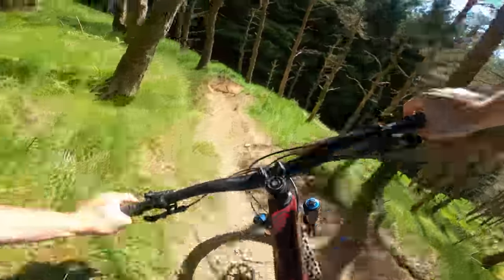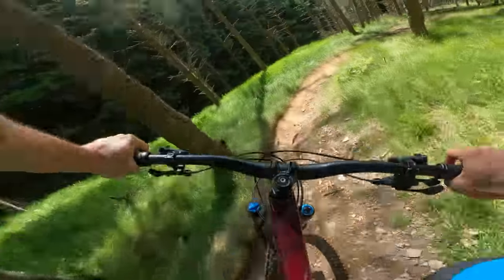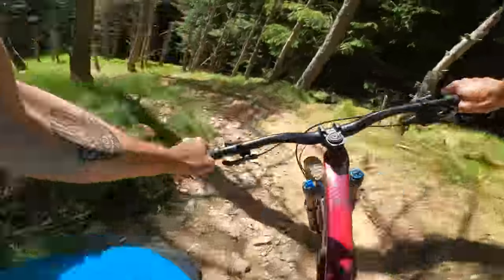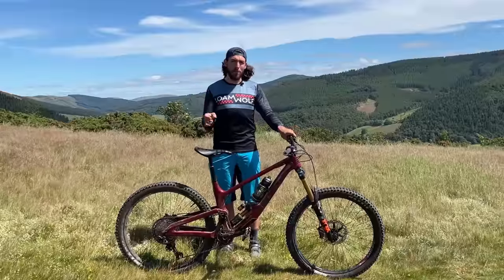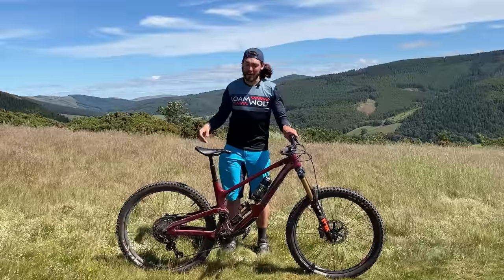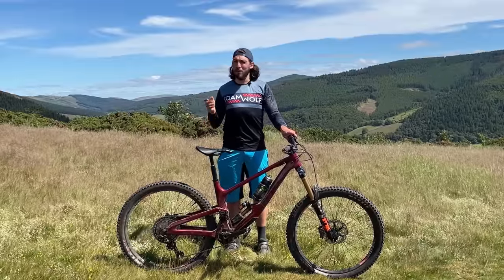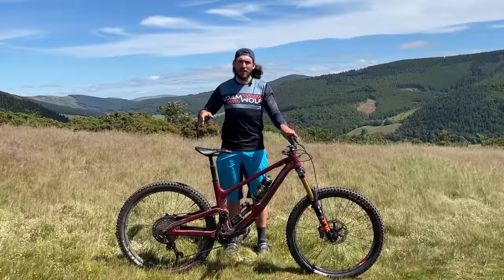However, the one thing that the bike is held back a little bit by, in my mind, certainly when you're attacking rough and rugged terrain, especially if you don't know the trail very well, so you don't know where the braking zones are, and you're maybe dragging the brake a little bit more than you certainly should be, which I'm certainly guilty of, is the anti-rise, the brake squat, is reasonably high, almost excessive, to be honest. So if you are on that brake, dragging it or braking through choppy, rough terrain, that rear end really firms up. It doesn't rise, you don't get pitched forward over the bars, but it certainly firms up to the point that it can become quite uncomfortable, especially on extended descents where you don't know them and you're braking in the wrong places through rough terrain, which of course is an element of rider technique to that.